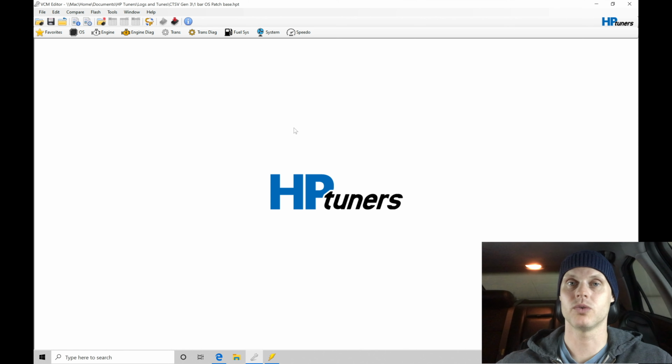So I want to go and just eliminate any airflow registration, any influence from the mass airflow sensor to simplify this process. Again, keeping things stripped away and as simple as possible is the best way to start off in the calibration process. We've changed a minimal amount in that last video, creating our base file. So only the things that we absolutely had to go and change and update, that's what I've started with. And then again, we're going to be reviewing those changes here in this video to see what we need to actually alter beyond that.